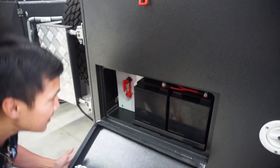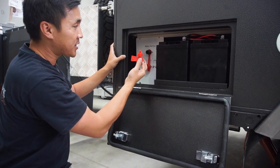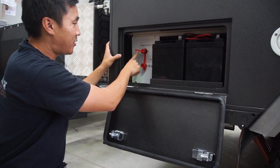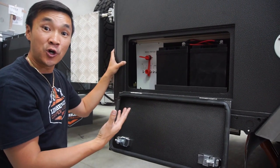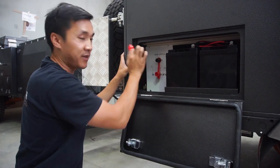You've got your battery compartment here. You've got your dual batteries — they're pre-wired for you — and your main isolator switch here. That's the isolator switch, currently off. Push it in and turn it 90 degrees, that's now on. And you've got your fuses down here. When you're travelling along, if you need your fridge on, then you actually need the isolator switch on at all times. When you've brought the camper home, that's now off.